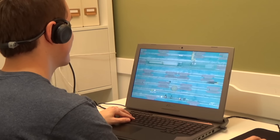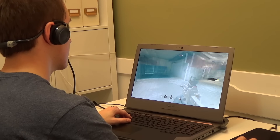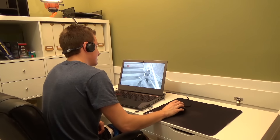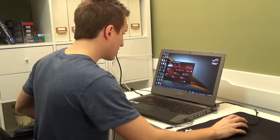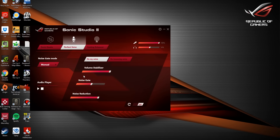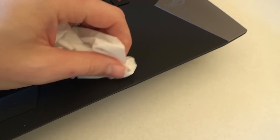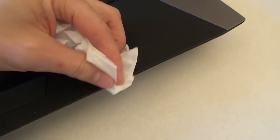Seven, when you use your microphone on the G752, you'll notice that it will cut in and out. I've had friends tell me they couldn't hear me right. I've noticed it's from the default settings in Sonic Studio 2 — all you need to do is turn off the noise gate and you'll be good to go. Eight, this laptop does show fingerprints around the keyboard and mouse pad, but it comes off very easily with just a tissue.